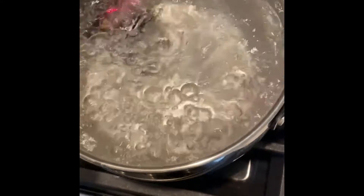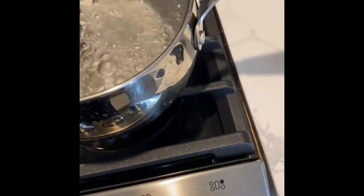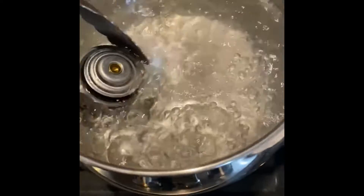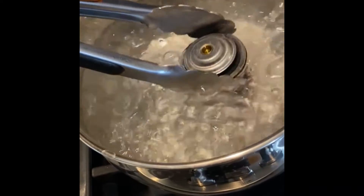We're definitely boiling — the thermostat is at about 105 degrees Celsius. As far as I can tell, it has not moved. There should be some separation on that black ring where it meets the gold-colored disc, but there's no movement there.